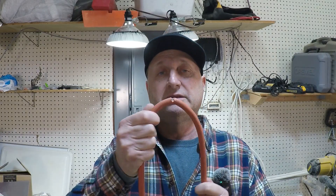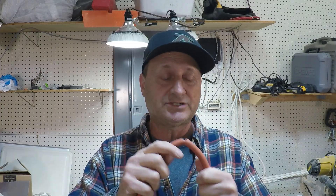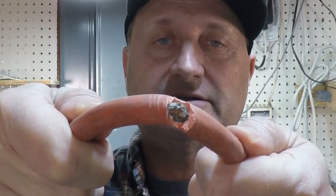Hello homeowners, today we're going to talk about how to repair an extension cord or even an appliance cord. You can see this one is cut and you can see some of the wire inside. This isn't safe — we don't want to just tape it up because we don't know if two of the wires are cut and they could be touching each other. So we're going to have to take this apart and put it together the right way.